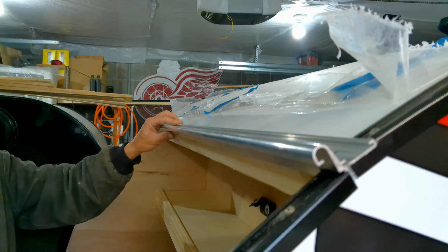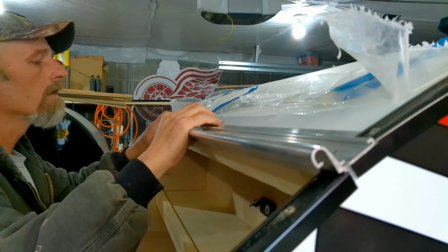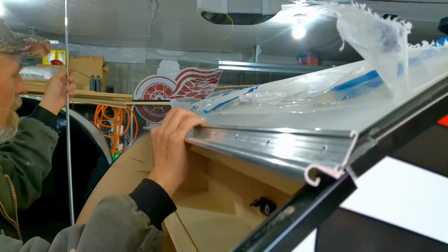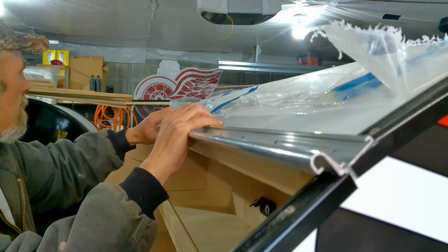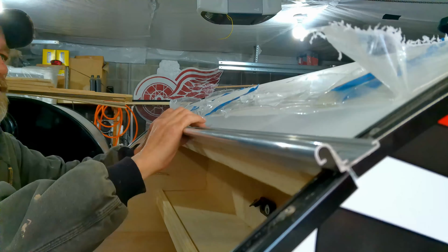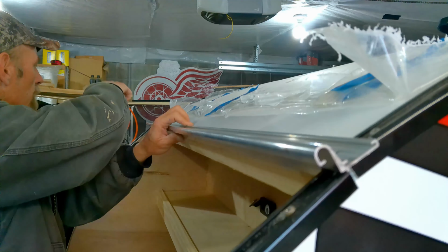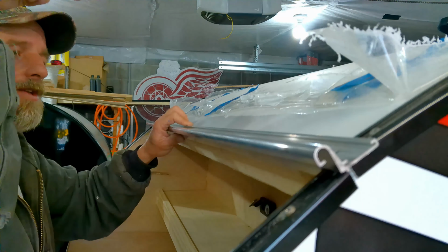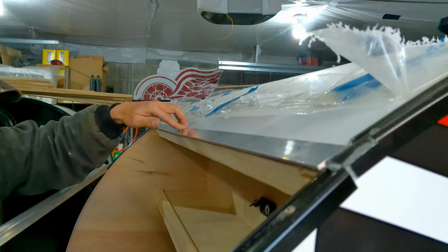and I drop it in between the roof trim, in between each end of the roof trim. It's 1/8 inch by 1, so it's pretty much the same size. Then what I do, once it's under there, is I take a magic marker and I mark where each hole is going to be in the hinge and pre-drill the ones underneath, so when I run a screw it doesn't resist into the aluminum.